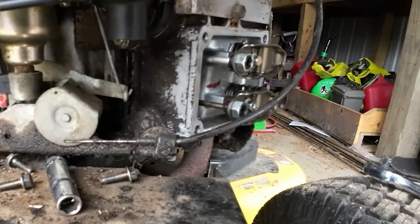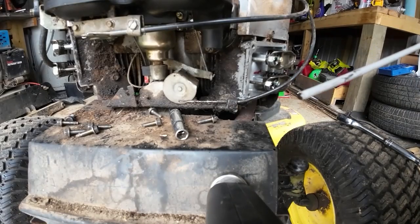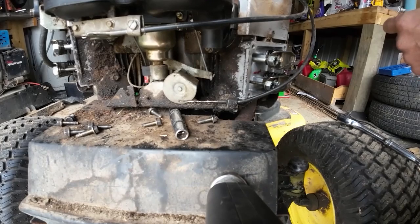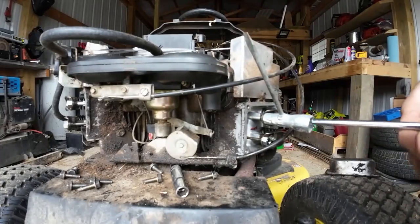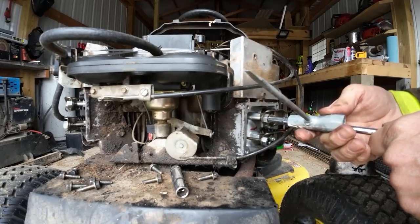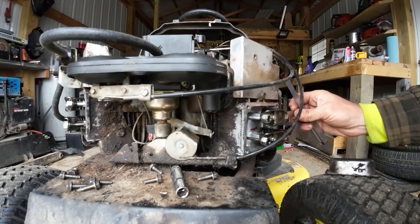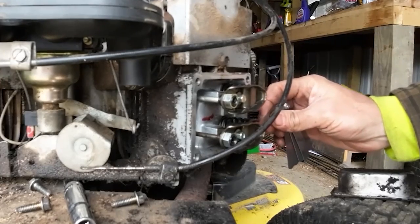Give her a few spins to make sure. I just used a welding rod through the spark plug hole — a little flux in the cylinder never hurt anything — and I've got her rolled around to top dead center where I want her. Got a little play, so it should be where we need it. I've got a T40 and that should be a 14mm wrench — break that loose. I've got just a little drag on the four-thousandths feeler gauge for intake, and the five-thousandths doesn't want to go in. On the exhaust, there's like a whole playground in there — way too much clearance.